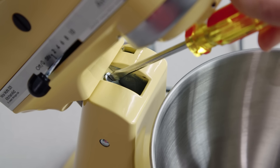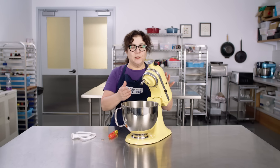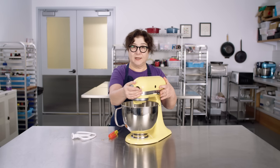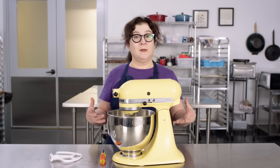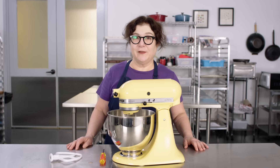You're not going to move the screw dramatically — move it like a quarter turn and check. If the beater blade is way too high, you will find that you can't lock the tilt head; it won't fully lock down and it will wobble. Now you've seen some of my favorite tips and tricks for keeping your kitchen gear in top shape. Let's go to Hannah for some of her favorites.